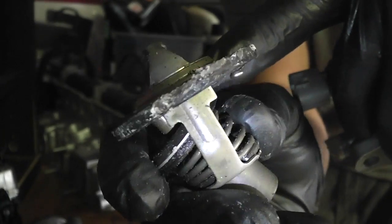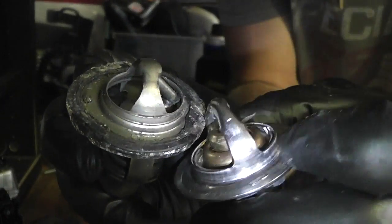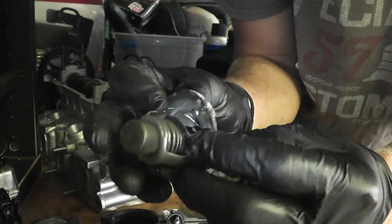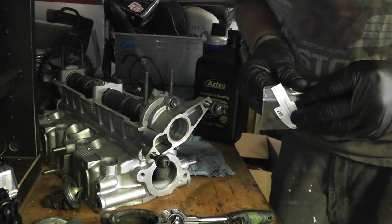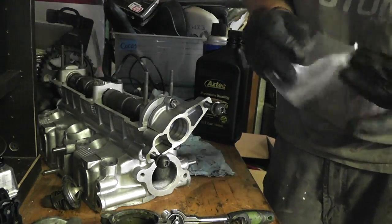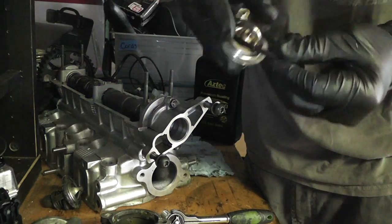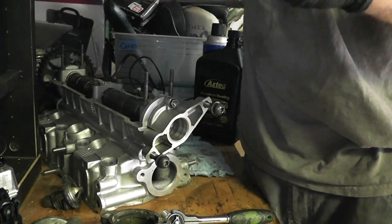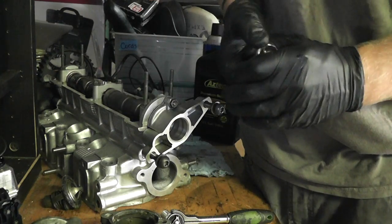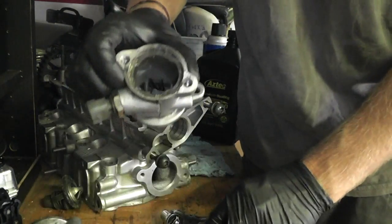You see that bent bit right there? That's not good. Look at the normal one — there's a pin that goes to the middle and it doesn't make a 90 degree bend in the middle. So that's a problem. It's got a rubber seal and I did order a new one, so we're gonna use this new one. Take that, stick it on — if you look, it's grooved in the back, so we just slide it around the thermostat. That still wouldn't explain why we're getting compression in the cooling system, but it might have had something to do with all the issues we were having.